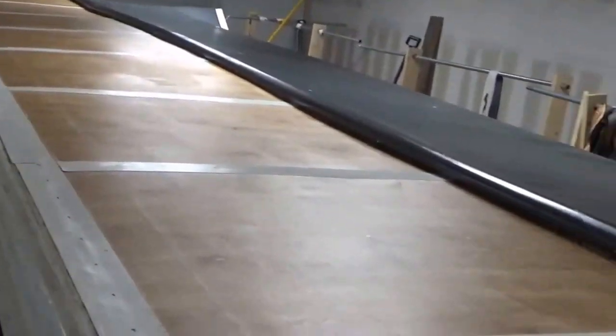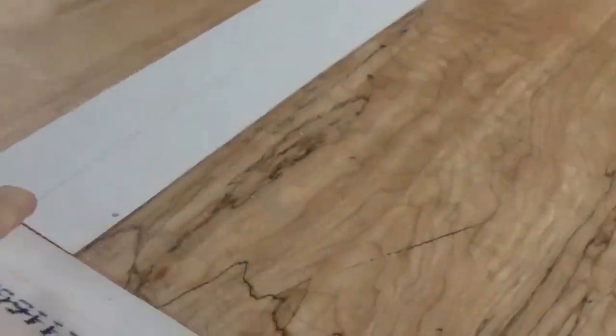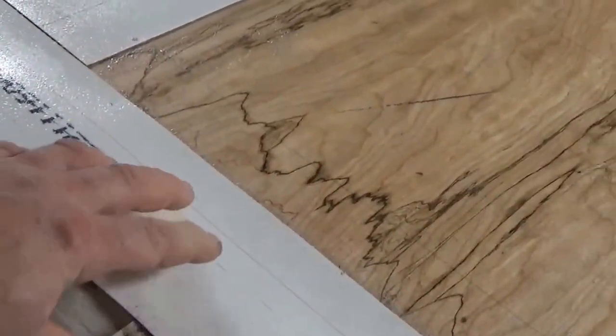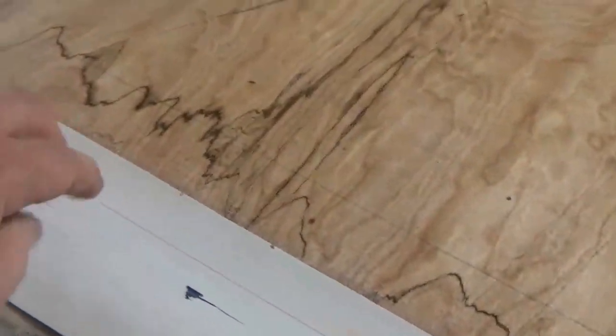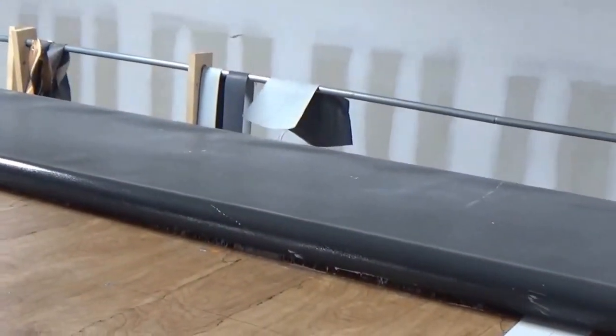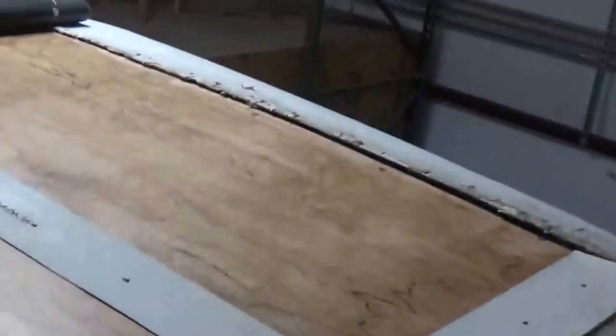Okay. This is our Georgetown. We got the new deck on there. We got our buffer strips in here. That's what I call them, these buffer strips. We ran them across. We're in the ones on the shoulder. When this piece comes up, it's just a thin piece of metal, but I want to make sure that it doesn't compromise the roofing at all. That's a heavy grade roofing. It's not going to, but that's just the way we roll here. So now we've already got the other side glued and rolled out, so we just did this side so you can see what it looks like. Then we'll mount our curbs, heat weld them all in.